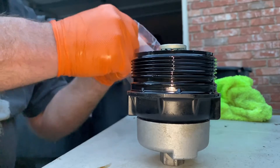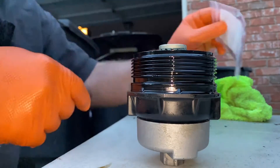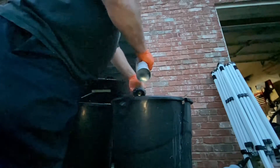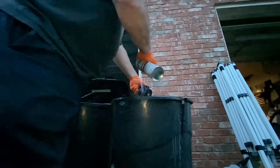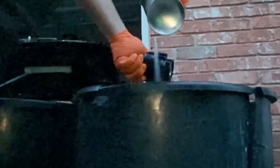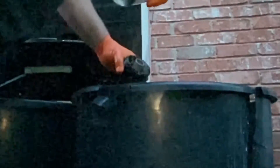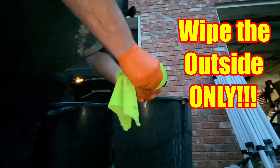Now let's go ahead and get the new O-ring out of the packaging and get it slipped on. But hold up — before we do that, we need to clean this. Get over your garbage can and get your brake clean. Give it a good hosing down. I'm mainly concerned about washing off the outside, and give the inside a little cursory clean as well. Now there you go — nice and clean. Take your shop rag, give it a quick dry down, wipe your threads out. That's it.